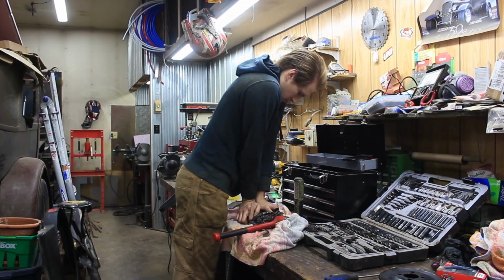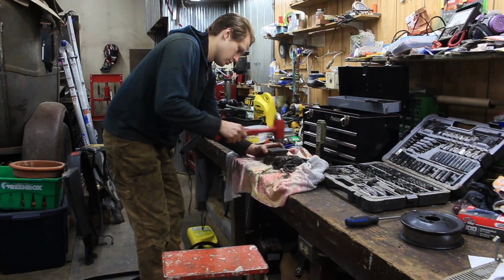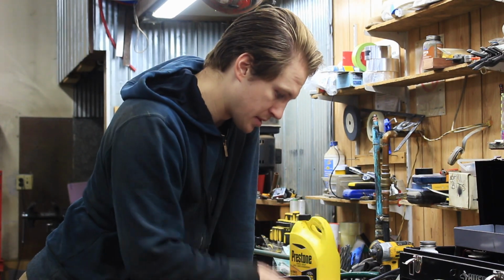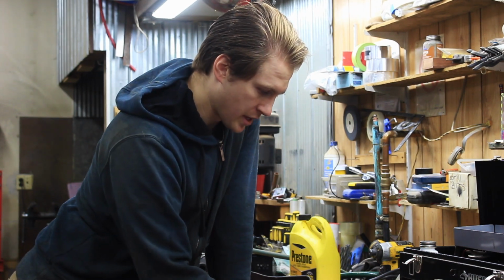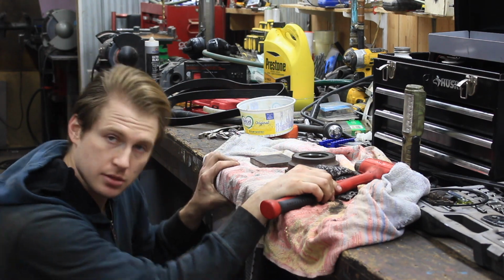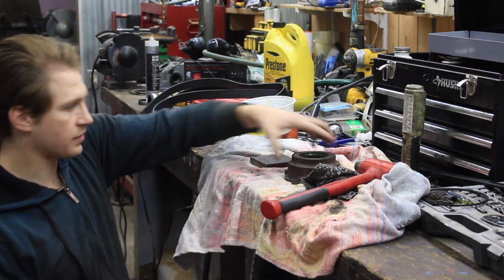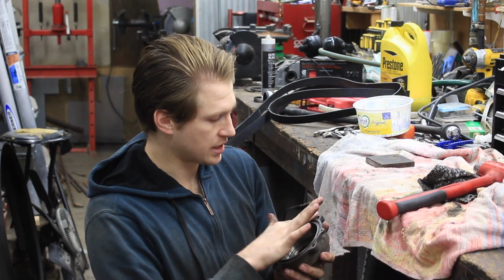the seal. Still tight, pushed it a lot of the way in just by my hands, trying to get it started, just slipped in pretty good. I just used a block of steel and a hammer. It's just supposed to be flush with the housing. So it's nice and flush, and it is just ready to be installed. So I have also wiped with Varsol the mounting surface in there that this is going to go onto. Want to clean it with something, but we are ready to install now.